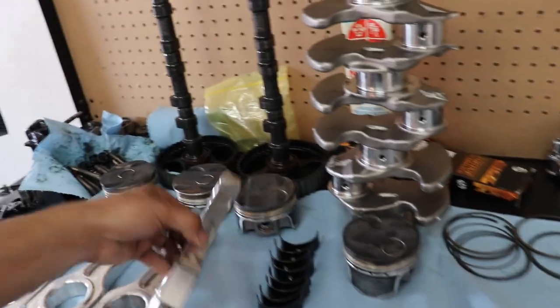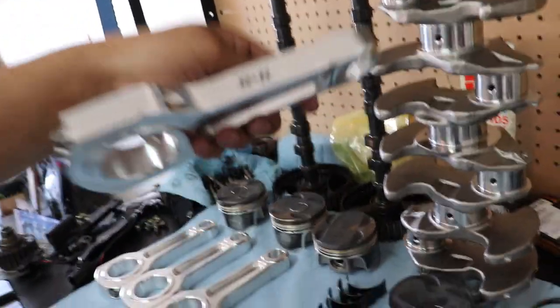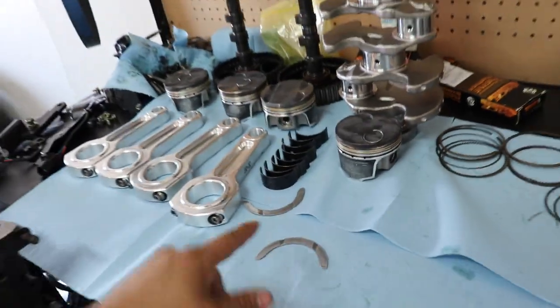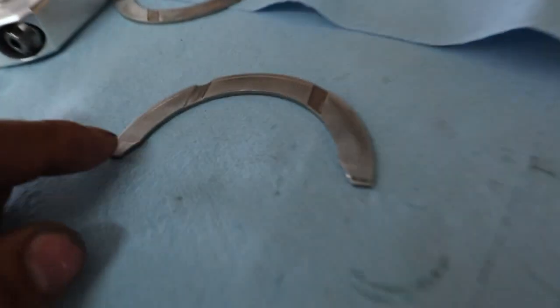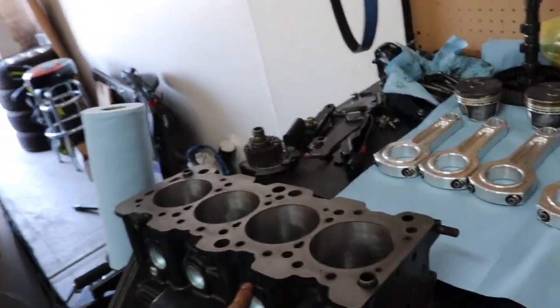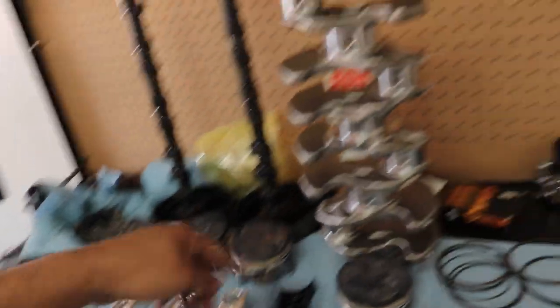Here's the catch — when I ordered all these parts from Extreme PSI, like these are billet aluminum racing rods which I still can't stop looking at. I totally forgot and spaced on the thrust washers. We're reusing the thrust washers because they only had about 500 miles and seem to be in good shape. Quick breakdown: we're using the stock 2.0 block because we're going to rev this thing to the moon, using the R&R aluminum racing rods with a standard OEM brand new crankshaft.